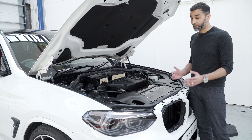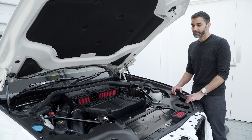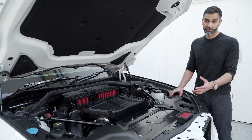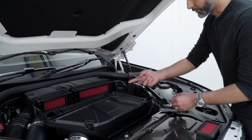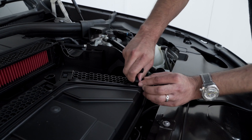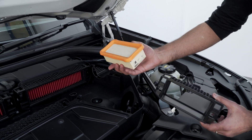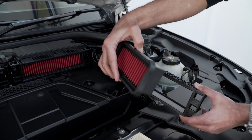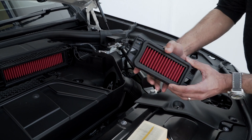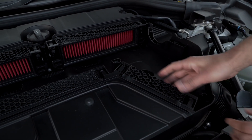We'll now show you our filters, scoops, and the carbon airbox lid. We've installed three new filters, custom made using the same material as our other cone filters. They're less restrictive than the stock paper filters, allowing the turbos to breathe with less drag. I'll take one out to show you how easy it is to fit. Here's the stock one — it has a clip mechanism, so just raise the clips, the frame comes out, and that's your stock paper filter. The new filter is exactly the same dimensions with a rubber sealing structure around it that slips into the frame. The entire frame then goes back into position and locks with the two clips. Simple.